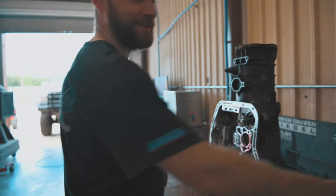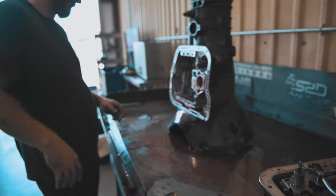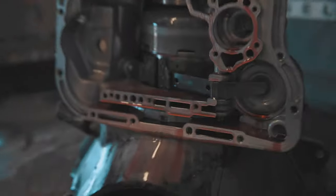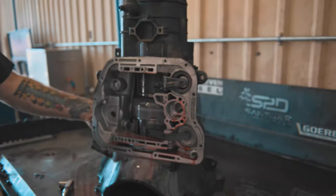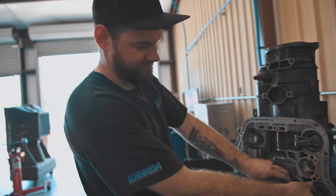You see that plastic thing? That's what I'm saying - this ain't no built transmission. And then the stock spring? And then all this is stock - lever, strut, anchor thingy. All of it's stock. That's your direct drum - that's third gear. So it goes from being stationary held to the next shift, it has to be driven. The timing between releasing the band and applying the direct clutch is very, very important. Or else you get a bind or a flare. Which is what this thing was having - a horrible flare. And then it all broke on like 200 horsepower.